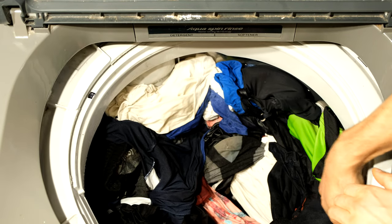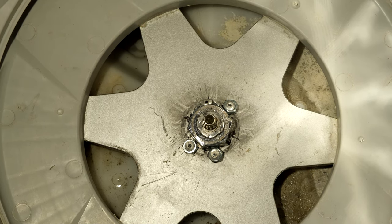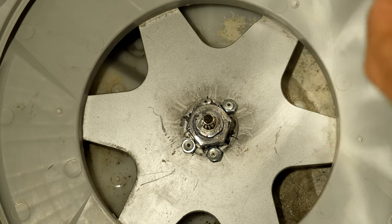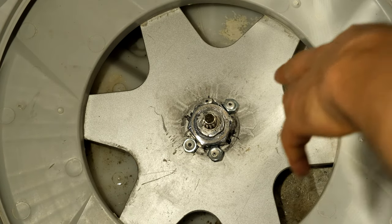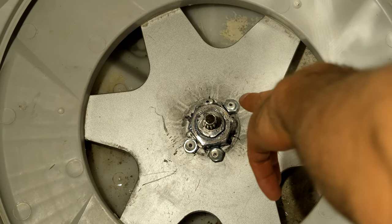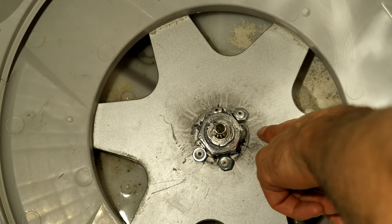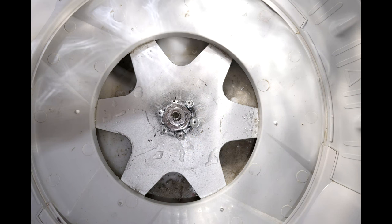There's very little free play — you can see there's still no lateral movement on this drum. I've removed the pulsator to check for any free play or change in what I've done, and there's been no movement whatsoever. Even if I try to move this drum it shows no movement, so I can consider this a useful repair. I'm going to add one more rivet there and there. I've now done 15 heavy loads and it's been more than five days — the machine has been used constantly with no movement. I finished by adding two more stabilizing rivet setups, and the washing machine is working perfectly.